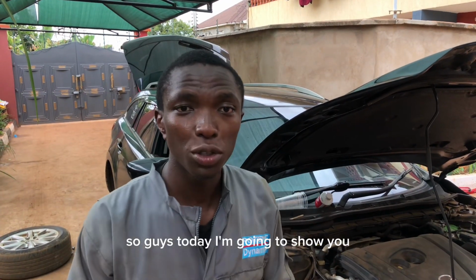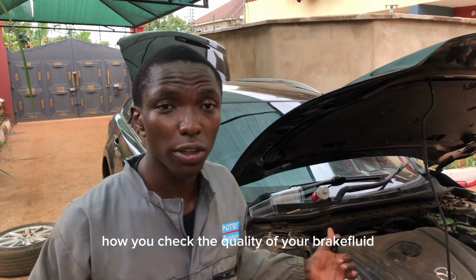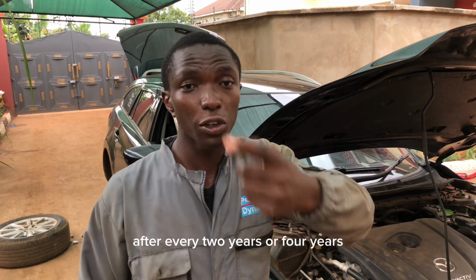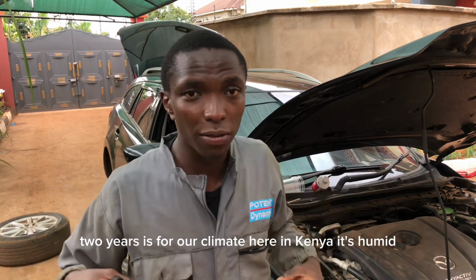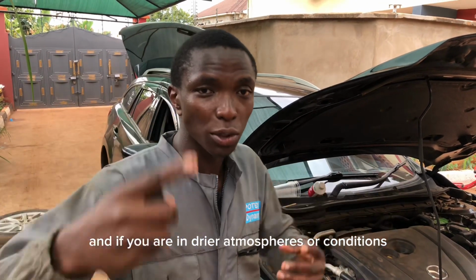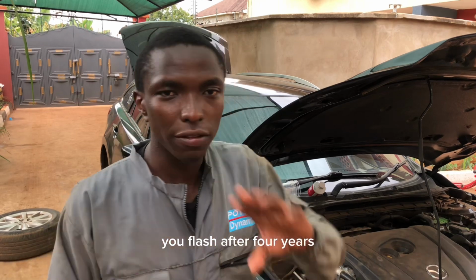So guys, today I'm going to show you how you check the quality of your brake fluid and why you should flush your brake fluid after every 2 years or 4 years. 2 years is for our climate here in Kenya, it's humid, and if you are in drier atmospheres or conditions, you flush after 4 years.